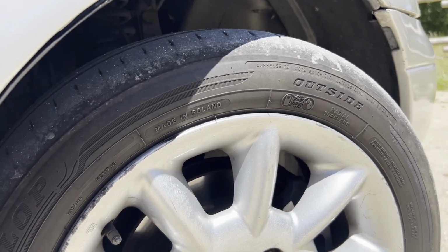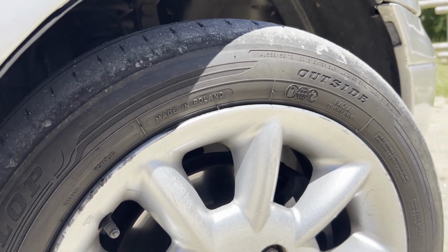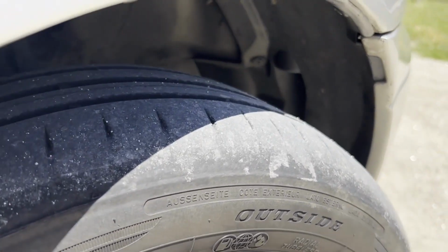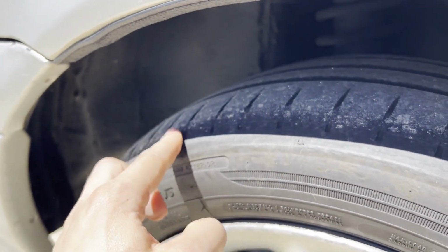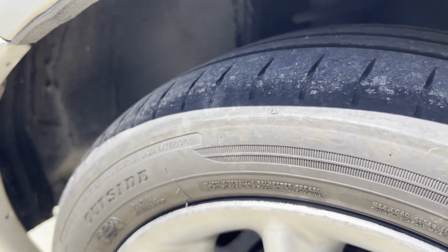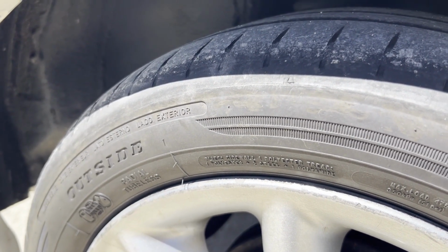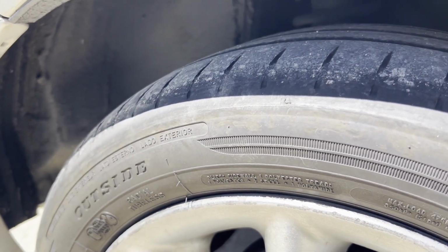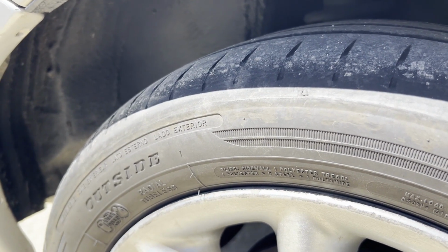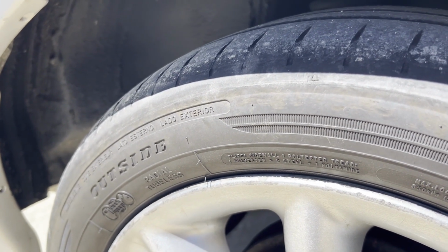That happened recently. I've replaced the tires in 2021, so 3 years ago. These are the ones that were at the back, so they are still relatively good. These ones, I don't know, because my spirited driving is killing them in here, on the side. I usually only fill them to 2.2 or 2.3 bars. Over that it gets a bit harsh. I know that would help with the wear on the tires on the side, but I'd rather replace them a bit more frequently than dealing with the harsh ride.